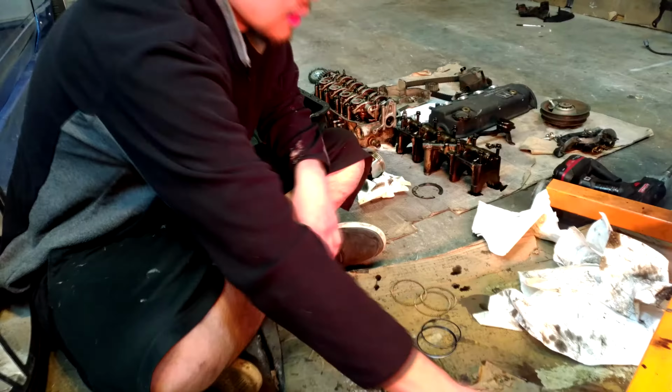Today I am reassembling this D15B7 engine. See if you can get a picture of it right there, all taken apart. I picked it up on Craigslist, and was told it had a blown head gasket. So, you know, it's Craigslist, I've gotta check out the engine. So I took it apart just to check the rod bearings and mains, and they seem okay. I figured, since we're this far in, may as well throw some new rings in there. So that's where we're at, and I will keep you updated as I go along.